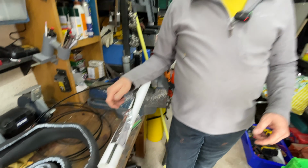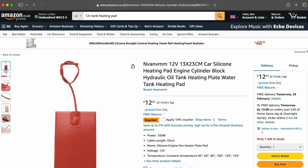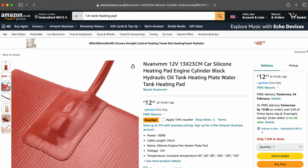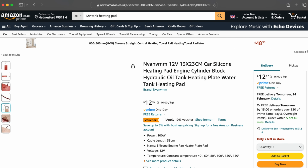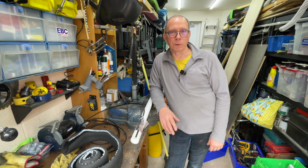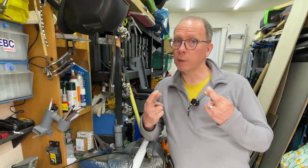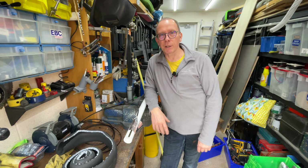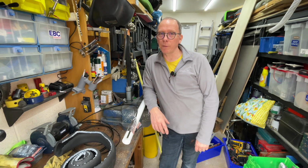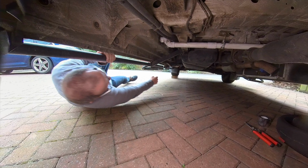The other thing is that I've got pads underneath the grey water tank, which are those self-adhesive sort of 6-inch by 8-inch pads which are stuck to the bottom of the grey water tank, and I'll be wiring those up with a switch from inside. When it's getting close to 0 degrees outside, we'll switch it on, and that will, fingers crossed, prevent our pipes on the outside from freezing. So follow me back underneath the van, and we'll get all this fitted, and then in a few weeks' time we'll give you an update from the Arctic, and again, fingers crossed, our pipes will not be frozen.